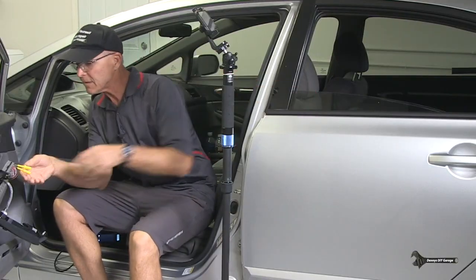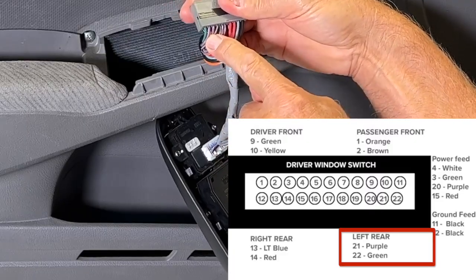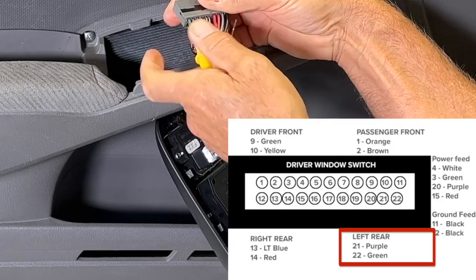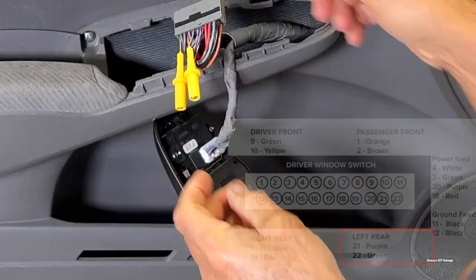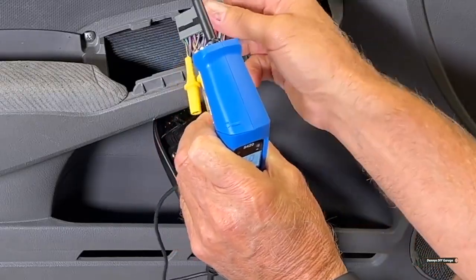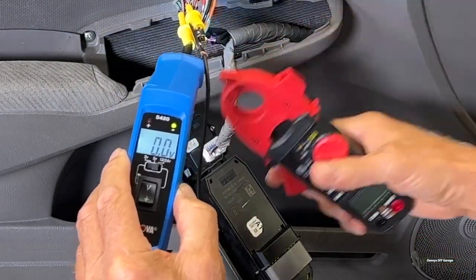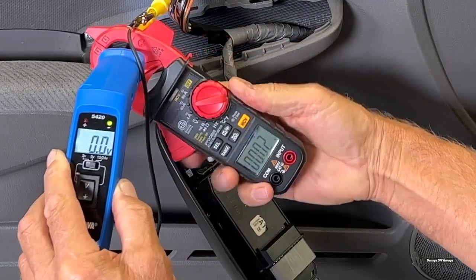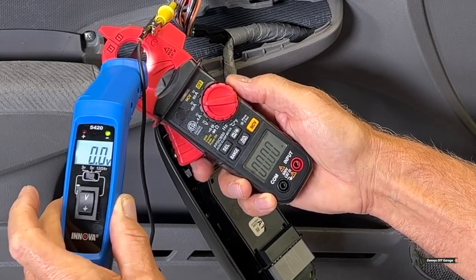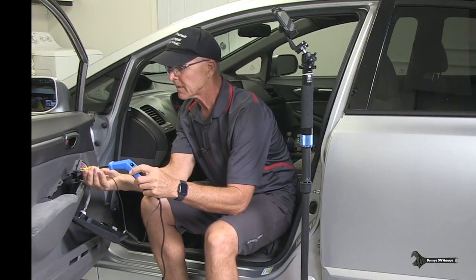The last window is going to be this one over here. We're going to do the same thing. This one's going to be terminals 21 and 22, and it's purple and green right here. So we're going to back probe the green. Take the power check here, put the ground lead on the purple, and the power lead on the green. Get the amp clamp, put it over the tip, zero that out, and power it up. Pull it off, switch this around, and power it up again.